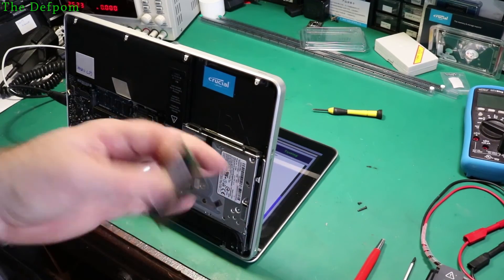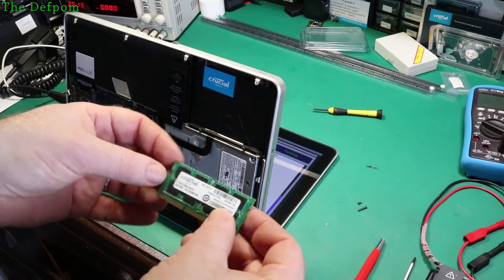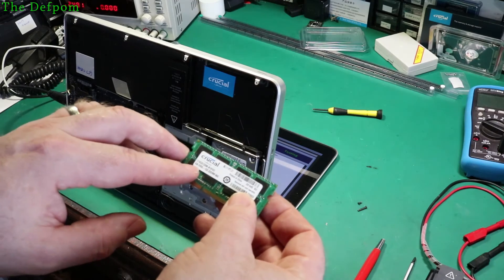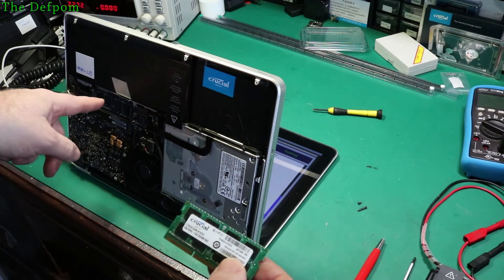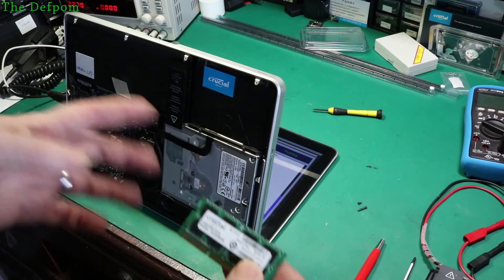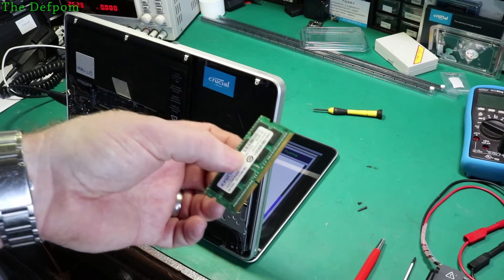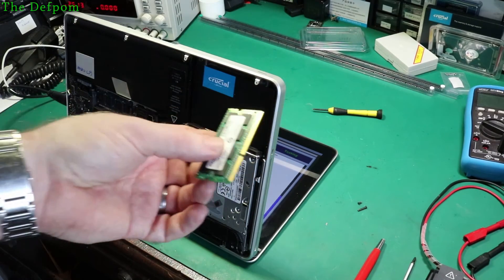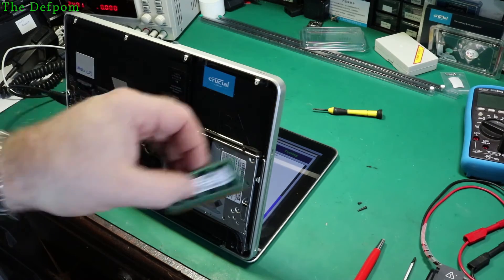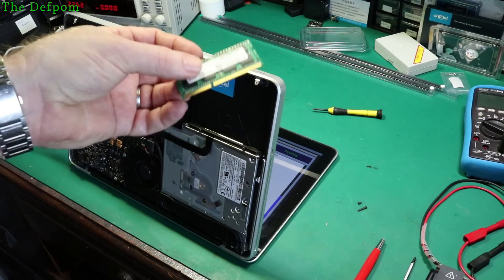This is a computer I was looking at before — this is obviously going to be attached to another piece of video. I've put this piece of RAM out here — this is the DDR3L which was in it, and it's got a DDR3 in it as well. That's a 2GB, this is a 4GB. So completely mismatched RAM. That may or may not matter — usually in this case it just makes the computer run a bit slower. Anyway, this computer wouldn't start up. It gave a RAM error until I took this module out, then it would half start.